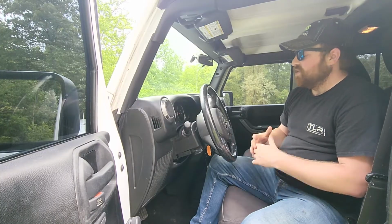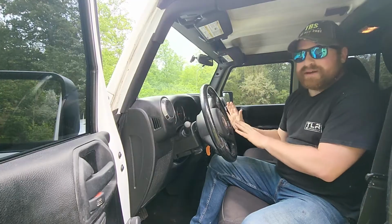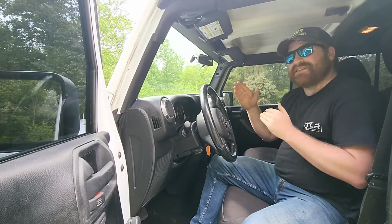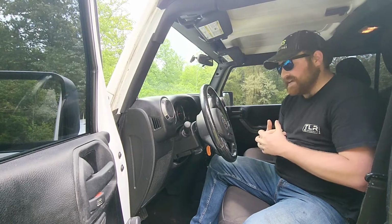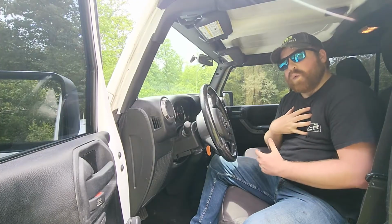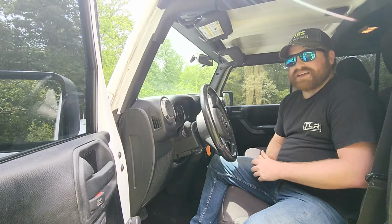And other things that you definitely want to look out for, if you don't have heat. Now, we talked about the blend door. That could cause it. It also could be the heater core. They do have a little bit of a tendency to get plugged up. And if you have a bad heater core, that is a major thing where the dash basically has to come out. It's a huge, yeah, it's not fun. I don't know if I personally wouldn't buy one because of it, but it's a project for sure.